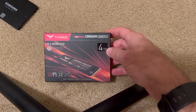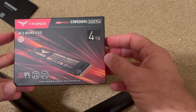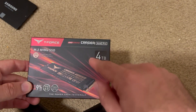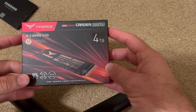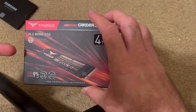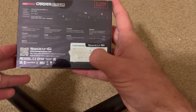So first and foremost, why this T-Force? Well, it was fairly well reviewed online with some professionals like Tom's Hardware and StorageReview.com — those kinds of places where they do a lot of extensive testing on SSDs for longevity, how long read/write speeds are maintained, latency, all that kind of fun stuff. This isn't a top performer; it's sort of average within the PCI Express Gen 4 range, but it does have DRAM, which was a requirement of mine, because then you don't need to use system memory and it operates more efficiently overall. You do pay a little bit extra for it, but this was $219.99 when I bought it — the cheapest with DRAM. There were more expensive ones without DRAM, so it just kind of hit all the bells and whistles. And it should still be DirectStorage capable, which was another requirement of mine.